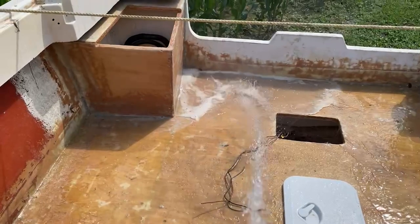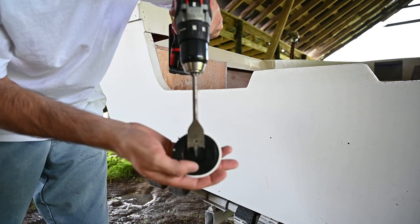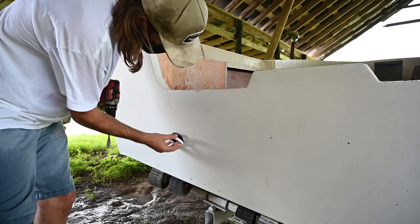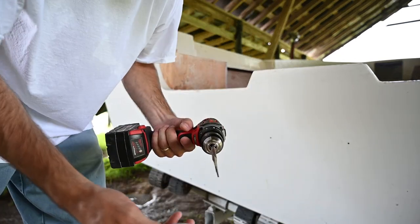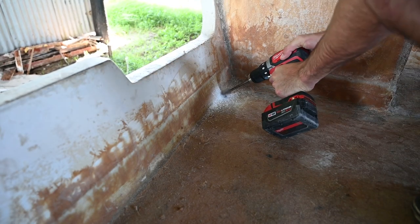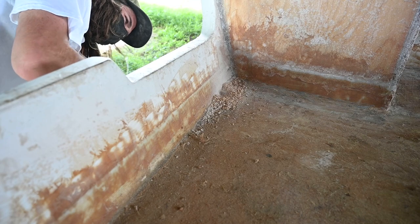You can see those are scuppers — I didn't show that part, so let's take it back to this morning. This is about an inch, and that's all I need right there. Smaller hole good, bigger hole bad. I've since learned a better method: drill a bigger hole than you need, fill it with resin, let that harden, and then drill your smaller hole through the resin so it's touching absolutely no wood at all.